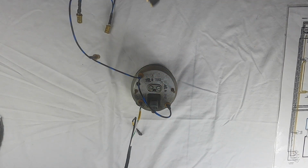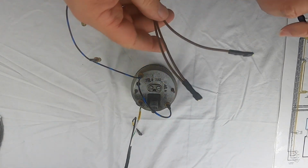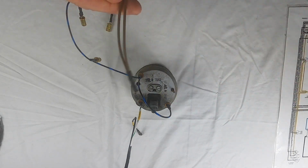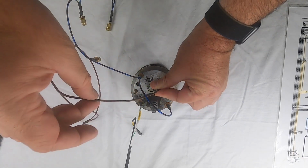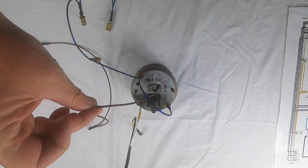So you would bring your harness in, which is a 3-gauge harness, a grounding harness. So it's got 3 tabs on it to ground the gauges. So it would stick on that tab right about there. So you'd have that coming in.